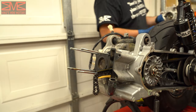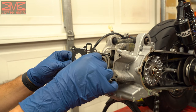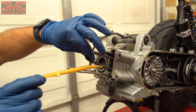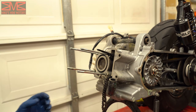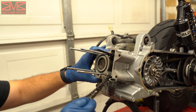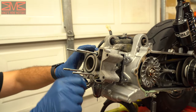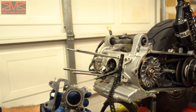Set that aside — we will be transferring stuff from this to the new head. Then take off the head gasket. Once you have that off, pull your lower timing chain guide out and set that aside — we'll be reusing that. Now we are ready to pull the cylinder off. Make sure to hang on to your timing chain so it doesn't slide in. Pay attention to the dowel pins.